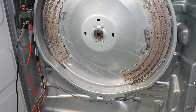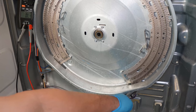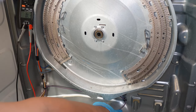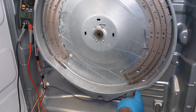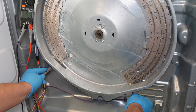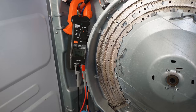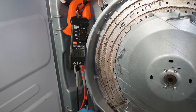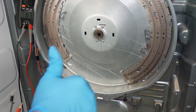Next, try the same test by taking the purple wire spade connector off on the right side. Keep the multimeter on ohm resistance and test the leads from the spade with the purple wire to the upper and lower connections on the left side. Regardless of what you choose, you should get about 21 ohms of resistance on either the upper or lower unit. If it's very far off from this number or you get an OL symbol, the heater or connector on the heater wire is bad and needs to be replaced.